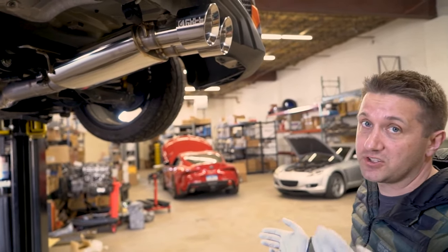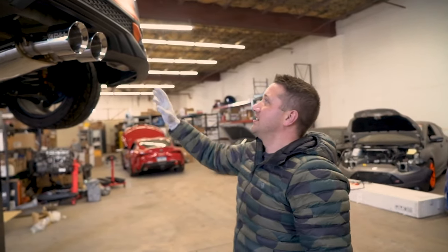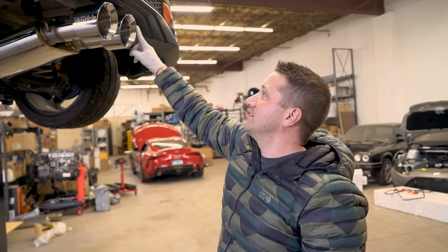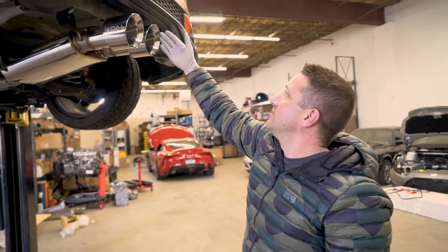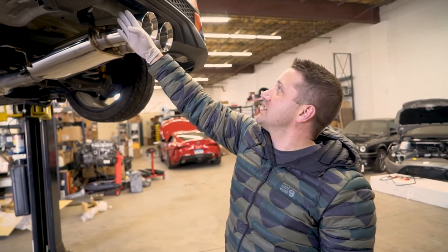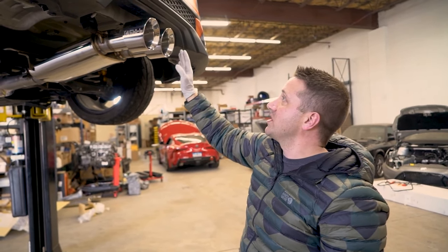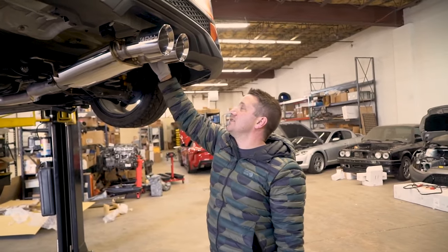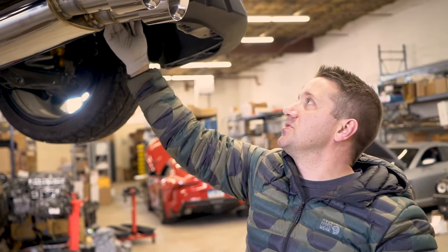If you want to take a look at it from the back, you can see that it's slightly to the right if you have the left bushing on. We actually tried to do it the other way around, and it moves it all the way to the left, the same amount as it is to the right here. So it's off center, and it just simply will not use these factory bushings. You can see right up here, this bushing just won't go in.